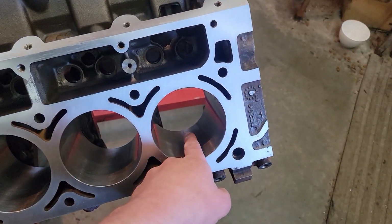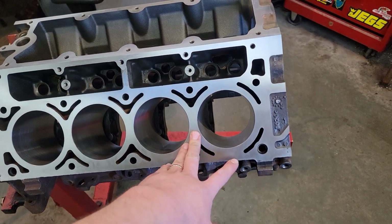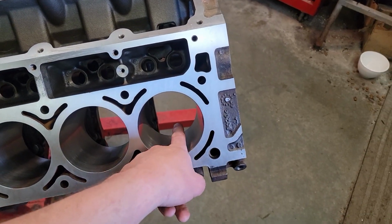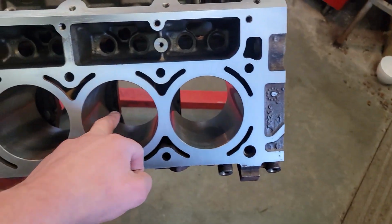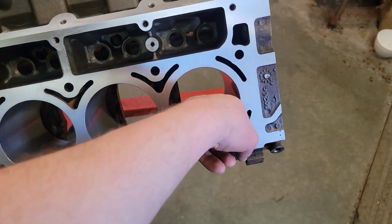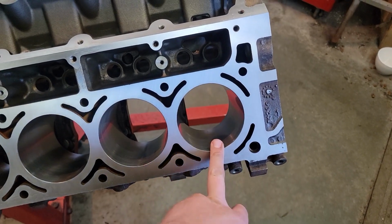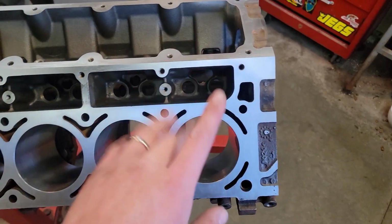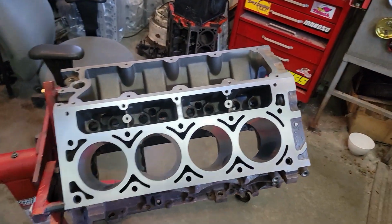One thing you want to do, because when you torque your heads on here, it distorts your walls a bit, you actually want to measure your piston wall clearance at the bottom, because at the base here, it's not going to shift around like your top will. So the difference between your bottom and the top, you will see a difference without your heads or without torque plates put on. So when you're doing that, measure from the bottom, not the top. Just a piece of advice there anyways.